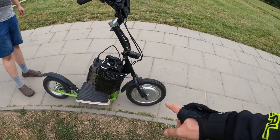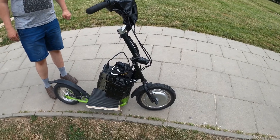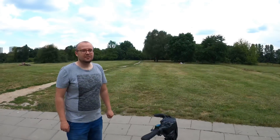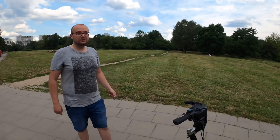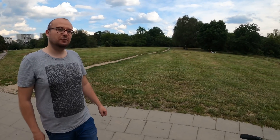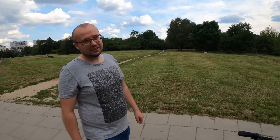These motors — electric unicycle motors, particularly from Inmotion 14-inch wheels or Kingsong wheels — don't have such a high top speed. It's more torque; they have a low RPM KV. So you can have tilt-back and balancing. The controller is a 38-amp, 60-volt e-bike controller — square wave. With square wave you have more acceleration and a more aggressive ride than with sine wave.